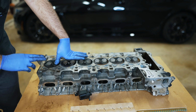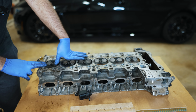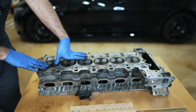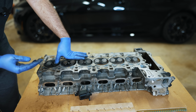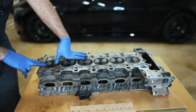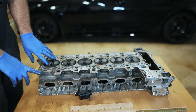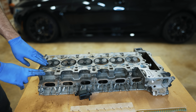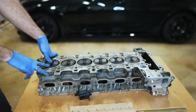You cut the spark. And you need to do that anyway if you have a really fast transmission, otherwise you'll get overrun, or you'll get a bog or a lurch when you're shifting gears. So that's where the DSG fart sound comes from on a modern BMW, even though it's not a DSG or dual clutch. It still needs to do something with the air and fuel, so it actually just dumps and wastes. It's kind of like waste spark for ignition timing.